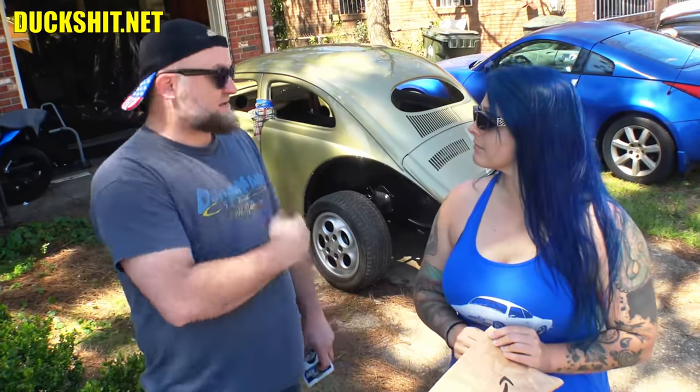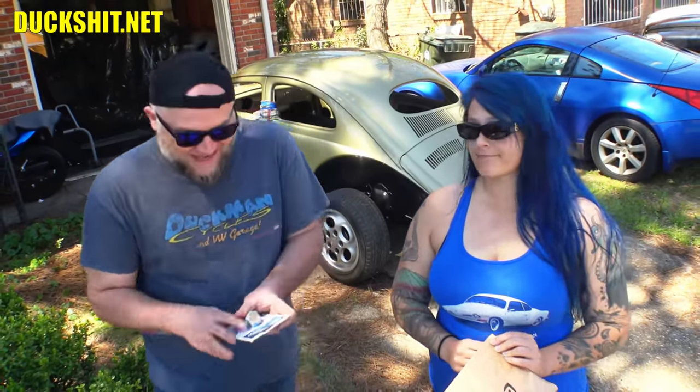I never heard such silly stuff in my life. Tins are always cool enough that you can put your hand on them without burning your hand, without risking that at all. And even if you took something like a torch and you heated them up red hot on a running engine, they'll immediately fade right back to cool and you can put your hand on it within seconds. And I will demonstrate that actually. Well, not on yours because I ruined your tins, but it actually will cool down that quickly because there's no thermal mass. The metal's what, a millimeter thick? Maybe. How much heat could it possibly hold? Not much! So the chrome tins are not going to cause us a problem unless there's a fitment issue. This is the caveat.